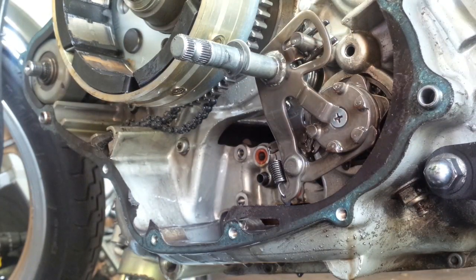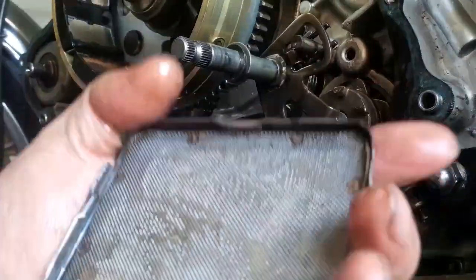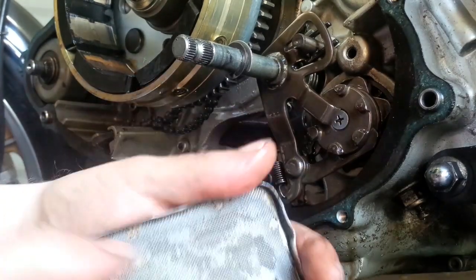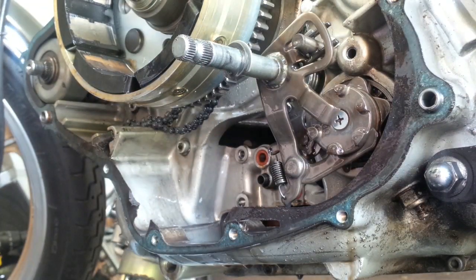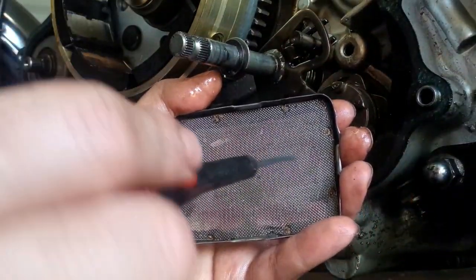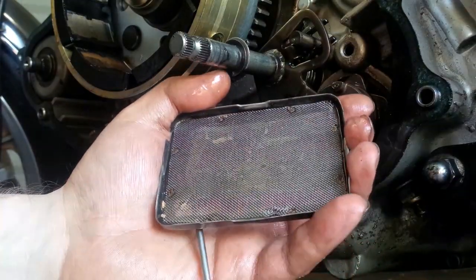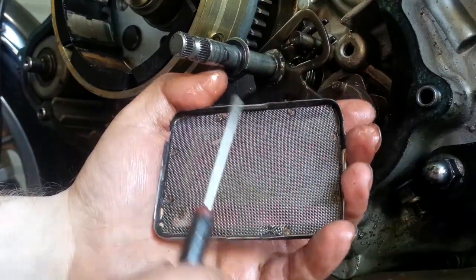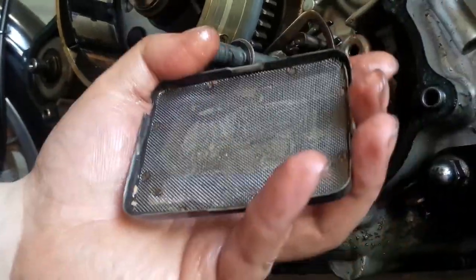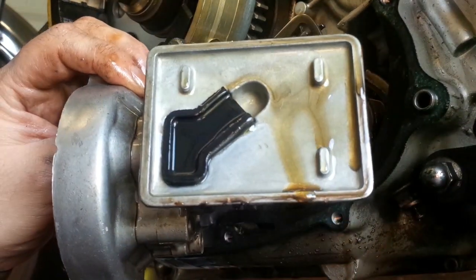As far as I can tell, those are metal shavings. The strainer caught those little metal bits. I'm going to spray some brake cleaner on here and use a screwdriver behind the mesh to get the rubbish out, to make sure it's clean behind the mesh. Once that's done, you can pop the sheet metal back on the pickup. If you see anything nasty in here, clean it.